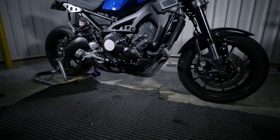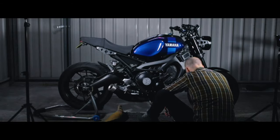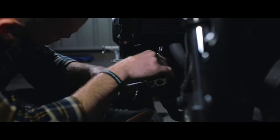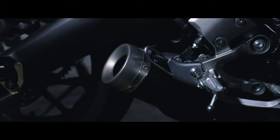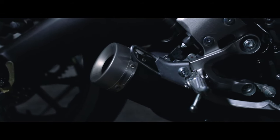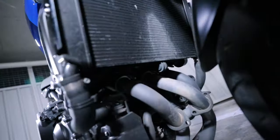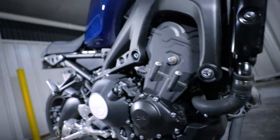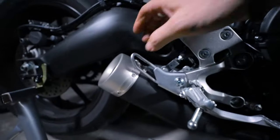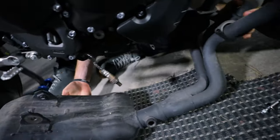It'll sit in there snug. So the first thing we're going to do is rip the exhaust off. Six 12mm nuts just holding those headers in under there — easy. Extension on the 3/8 drive ratchet and we're in business. Greenie's on the jiggle — she's gonna drop. There she comes! Look at that — bloody huge thing.